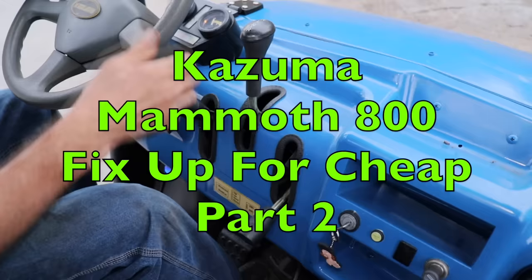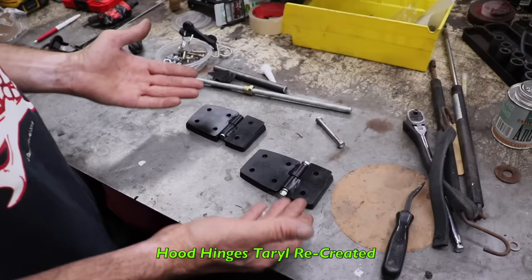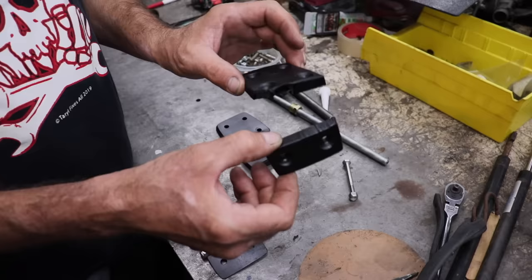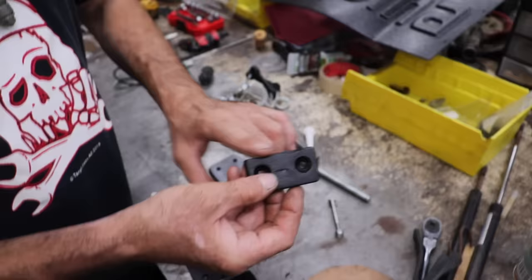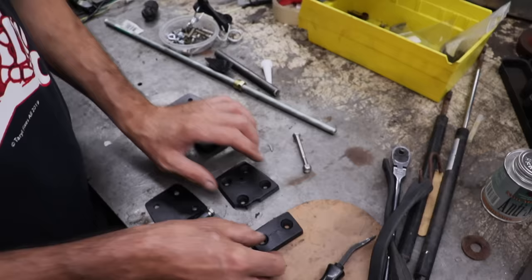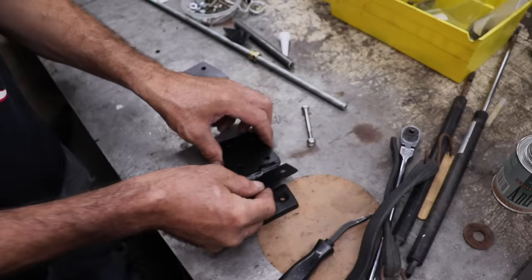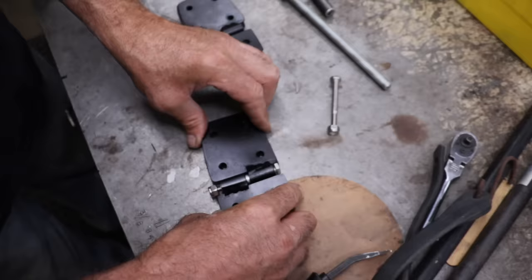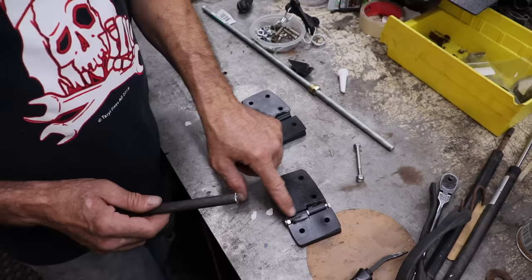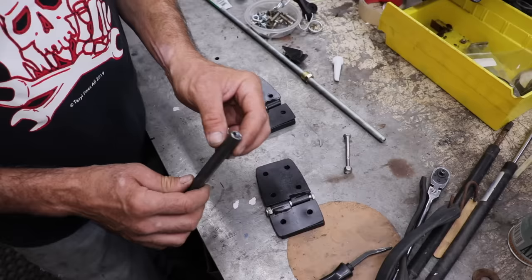Here are the hood hinges I made, and they work. I had to repurpose the old plastic hood hinges because I needed this spacing. I cut off whatever was on there, and then I put them in my sandblast cabinet because they were so weathered. I sandblasted them, then painted them. And then here are the ones I made out of steel. I needed this spacing to hold the hinge part off of the hood. I took some half-inch tubing, cut these little spacers, welded them on — MIG welded — then ground the welds smooth.